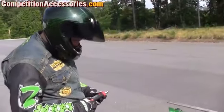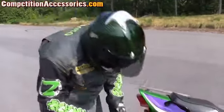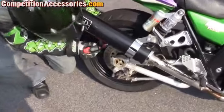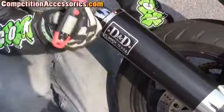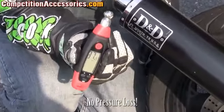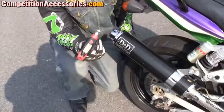We've put six holes in this tire so far. We're going to check the tire pressure and see what we're at. We're actually at 37.5 PSI. As the tires warmed up it's gained a pound and a half of pressure, which obviously means it hasn't lost any. Pretty impressive stuff.